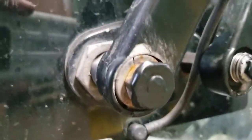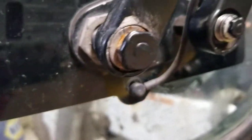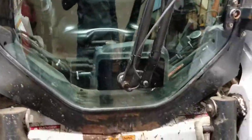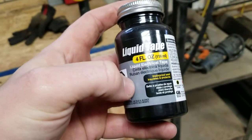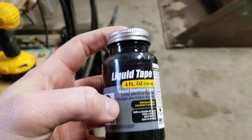You can see how these spin — this one will actually back itself out right there, while this one obviously doesn't spin. So over time that nut was backing itself out even with a locking washer on it. Anyway, that's just a hack. This stuff is called liquid tape, you can find it on Amazon. I use it for all my electrical connections — I solder the connections and put this stuff over it to seal out all the moisture. If you have any questions, leave a comment below. Thanks for watching.